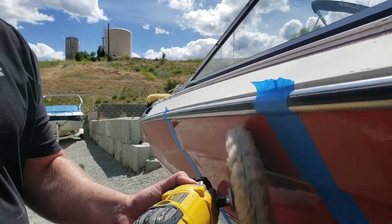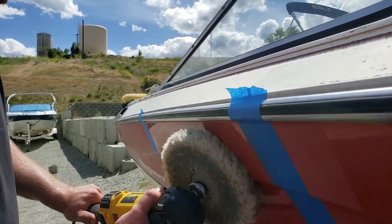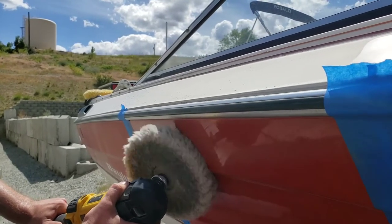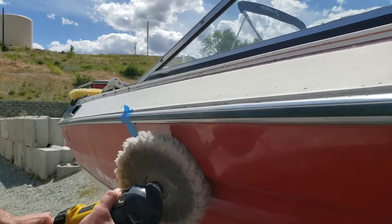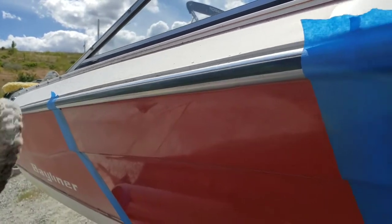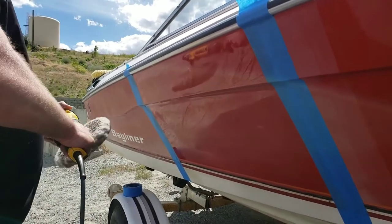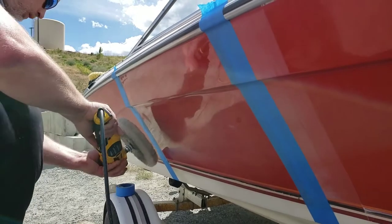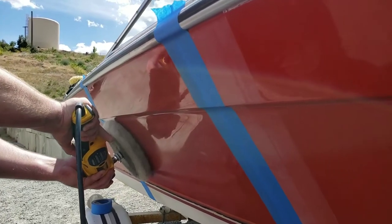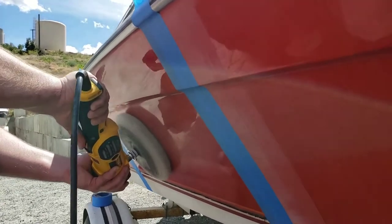And remember, you want to roll off of an edge. There you go. Now put some pressure on it and cut it. Nice and slow. Let that compound do what it's supposed to do underneath that wheel. Okay, now that you've got semi-gloss, go ahead and show me what your RPMs can do. Keep going. There you go.